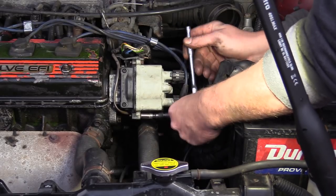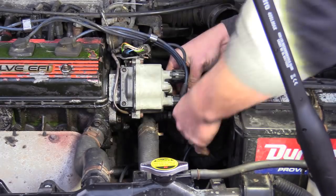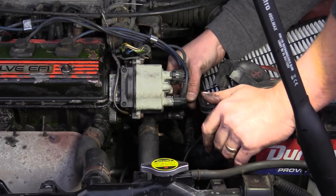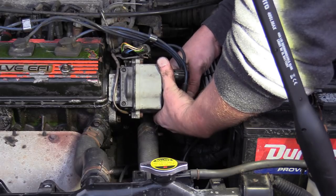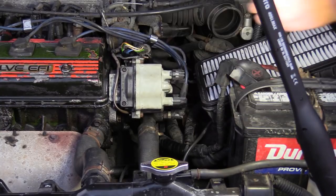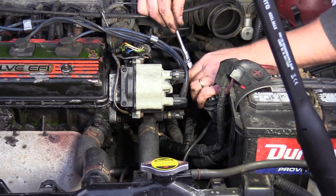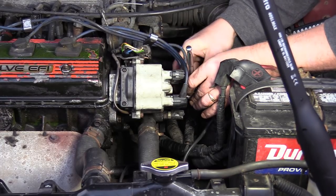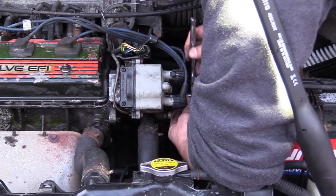I just hope this pickup coil in this distributor is okay, because that can cause a misfire too. Remember, this distributor had an issue — I don't know what the issue was; I was just being a parts changer. I had a distributor code and I swapped the distributor out and it fixed the problem, back when this engine was replaced. This is the distributor that was giving the issue. However, I just swapped out the ignition coil and the ignition module from the working one — although the ignition coil was originally in this one, so we'll see.